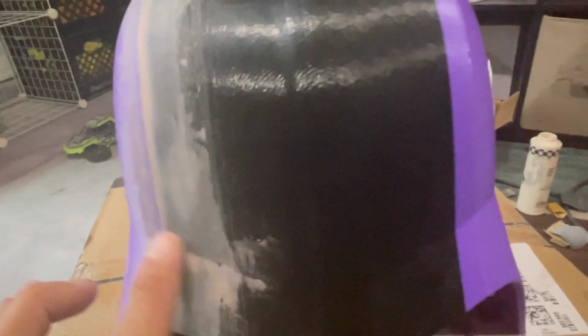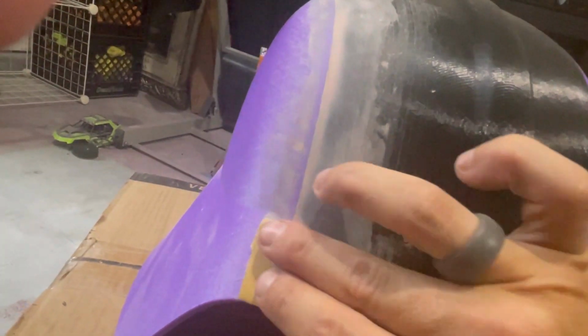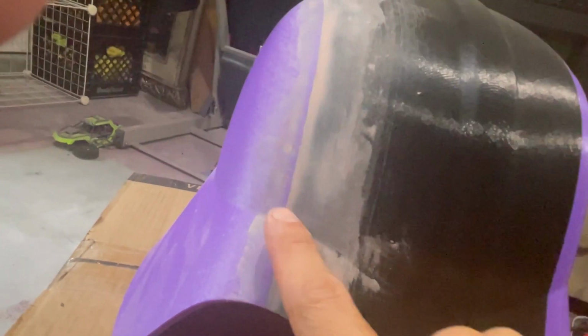What I'll do is I'll take some polishing pads, something that has some squish, and I'll use it to sand like that. Now you could use, like I said, a wallet or something like that. I just had these out here right now. When I do my finishing sand, I always use my old beat up wallet. It works really good. In here, what I am doing, I'm actually just kind of freehanding it. I'm not really using a wallet or anything. I'm using the contour of my hand just to kind of stay along this line here, and then along this line here, just to keep it very smooth.